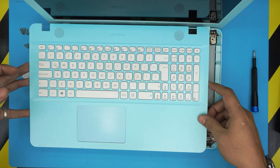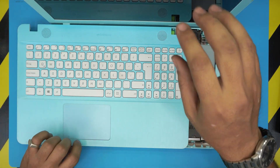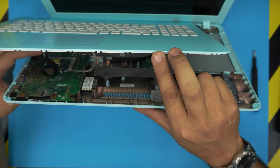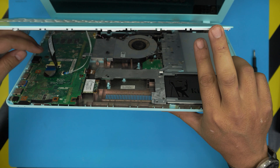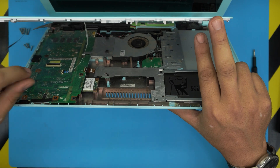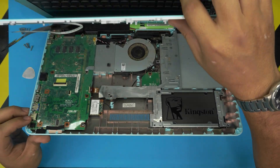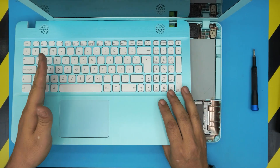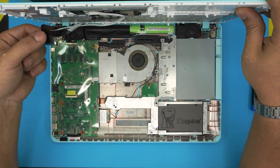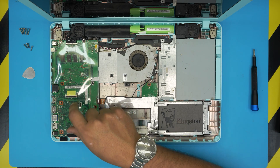Lift up this whole area about one centimeter upward — not more than one — then bring it towards the left and set it down so the speaker matches over the screen. Now lift it up slowly. There are two ribbon cables to disconnect: the keyboard — put your finger at the back by the clip, lift it up, and slide out the ribbon cable. Same thing for the trackpad: pull back and slide out. We shift the keyboard to this side to have more room to work with the flex cable, otherwise you risk damaging the flex cable or the contact.